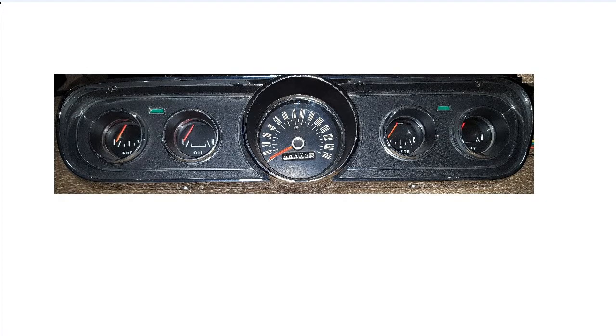A friend of mine wanted to put a 5-gauge cluster from a 66 Mustang in his 65 Ranchero. The biggest issue that confronted him was the ammeter. The Ford design is an ammeter with an external shunt, which the Ranchero does not have any provisions for in the wiring. Adding a shunt would mean running a battery hot wire into the dash, which would not have any fusible protection, just like the wiring in the 66 Mustang, and he was not happy about that.